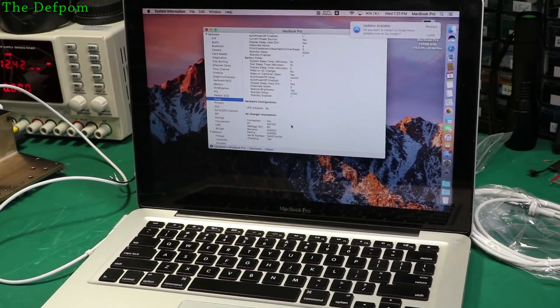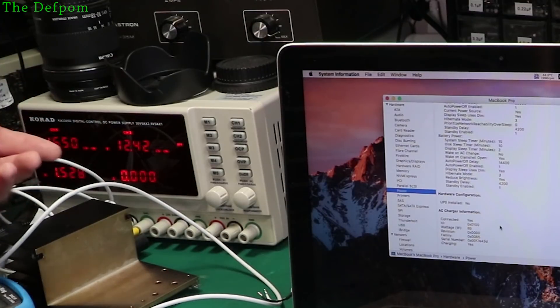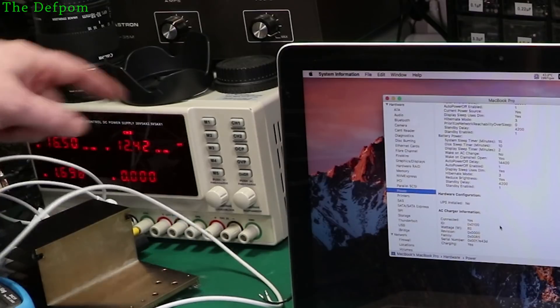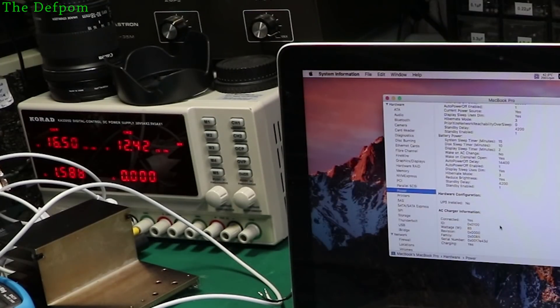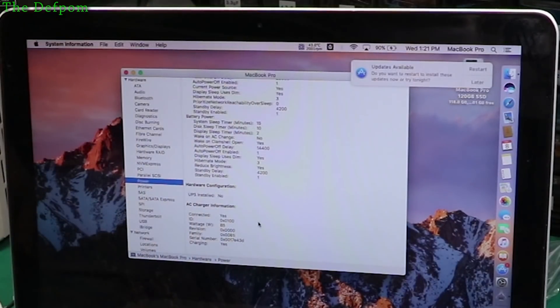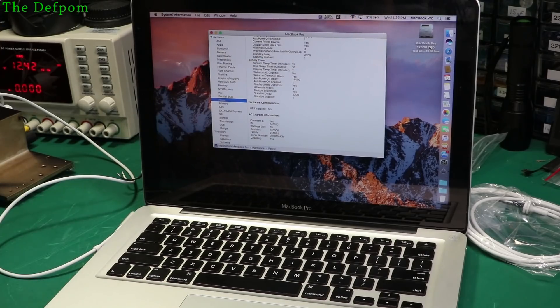All I'm doing is manipulating the voltage on here to set the MacBook — 18.5 volts if it's a 15 or 17 inch MacBook, and 16.5 volts if it's a 13 inch, because that's what they require. It's working and it's charging. I just want to see the number go up to be sure, and it has — so it's definitely putting power in.